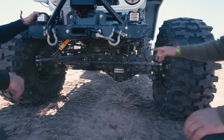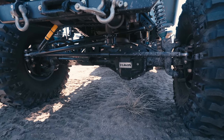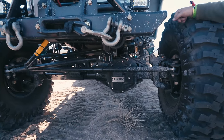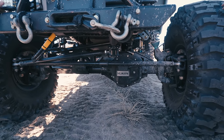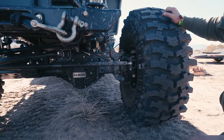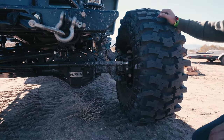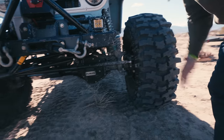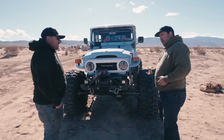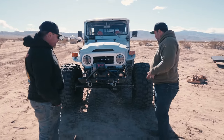All right, you got a Barnes truss there, and then the coilovers are mounted to the top of the knuckle, just like we sell our stuff to do. Yep. And it looks like you did the weld-in Heim joint kit, semi-high steer on the stock knuckles, right? Yep, exactly. Being that it's a Super Duty axle, it's got a metric lug pattern, correct? Yeah. 8-on-170. Full width.